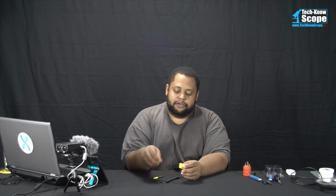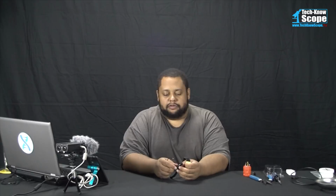Now, if you touch a semiconductor with static buildup and you shock that device, you can actually break down that barrier that keeps a transistor from conducting. And basically what you can do is blow the barrier wide open, meaning that when the transistor comes in contact with the voltage of the system, it's like having a dead short. And if you've ever seen shorts, basically you end up with smoke, fires, things popping, and basically you have a dead device.